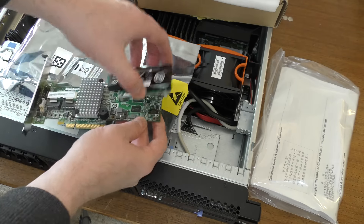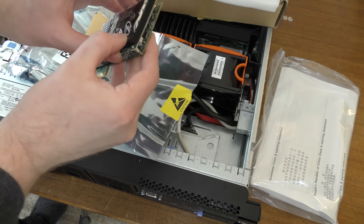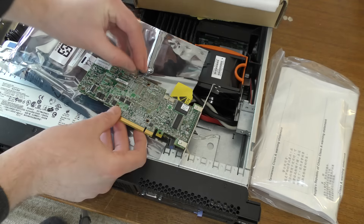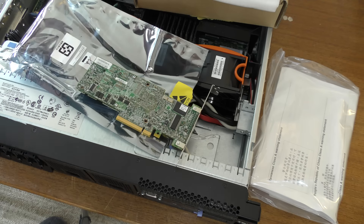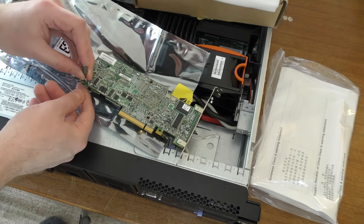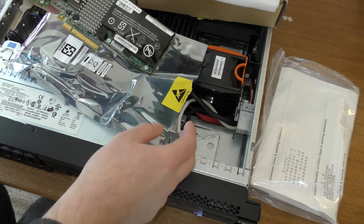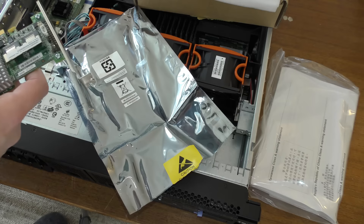Let's install the battery with the three little screws. There is a connector for the battery — that's the only one that goes in here. Line it up with the holes, be careful about this cable, push the connector in place, and then use a Phillips head screwdriver. It's a rather delicate board with a lot of small surface-mount electronics on the back — tiny resistors and stuff — so be very careful. I don't think I need more than hand tightening. That's the RAID controller. Now let's install it — it'll sit right here so I'm going to remove the bracket.